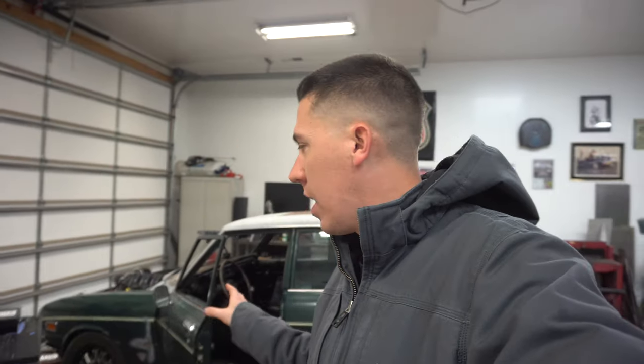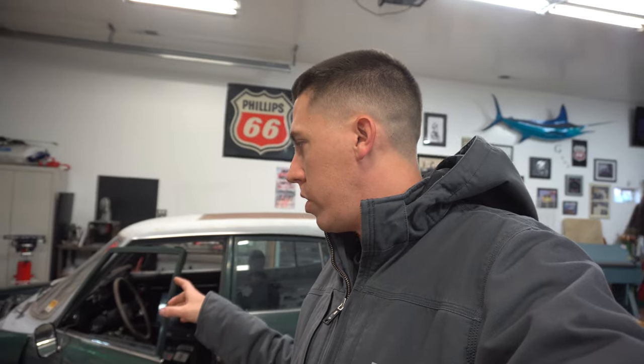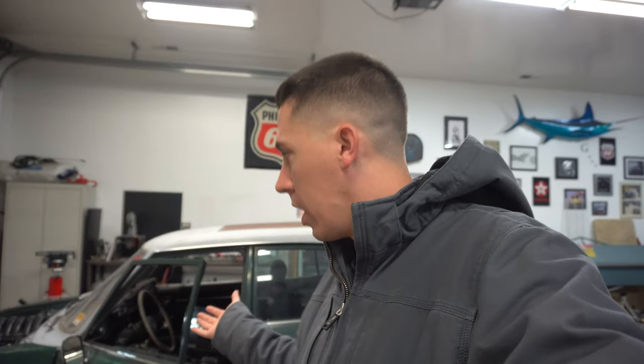Another thing with this car, it has a super tight converter, but converters can play havoc on the dyno because the dyno will throw load at it, the converter won't hook, and then try to give it all the power. So you kind of run into this weird state with the converters. So I'm going to play with that some right now, try to get comfortable, play with some settings, and see if I can get some repeatable runs out of this. Then I'll feel comfortable knowing what settings work for me and what I need to do with the car to get repeatable results.